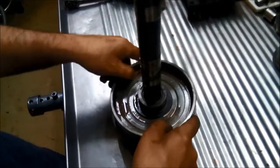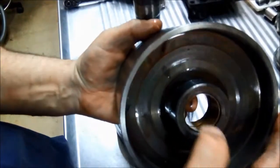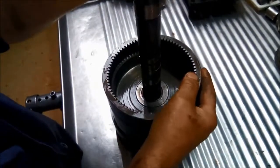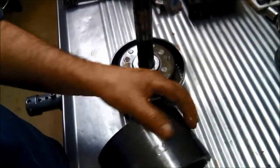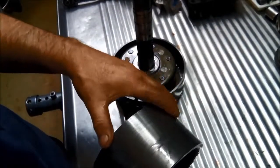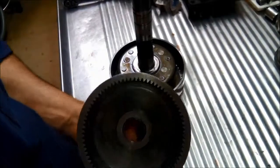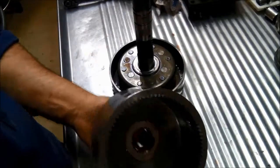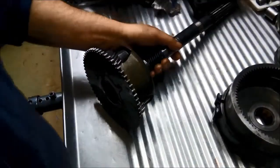I've got the drum where the rear band runs - it's also got a bush on it. I'm going to put that on backwards so we can see how much play there is. There is a little bit of slop in there, so we're going to replace that one. We'll have a look - there are no hard spots on it. I'm still going to polish it up a bit to make it nice and smooth and level. Also going to take note of all those teeth on that annulus, the one that runs on the planetary, and just make sure there are no chips or any excessive wear marks.